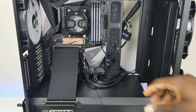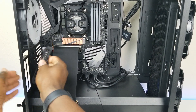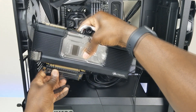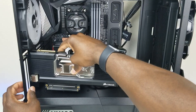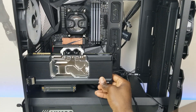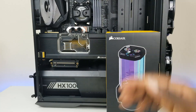The GPU will sit like that once it's in. Before installing, we take out the two bracket pieces and unscrew them so the slot slides out, leaving an open slot. Then I flip out that part, the GPU sits directly in and snaps in place. Once secured, we make sure everything is sitting properly and secure the screw. Next we connect the main power to the GPU — this is the eight-pin and a six-pin connector.